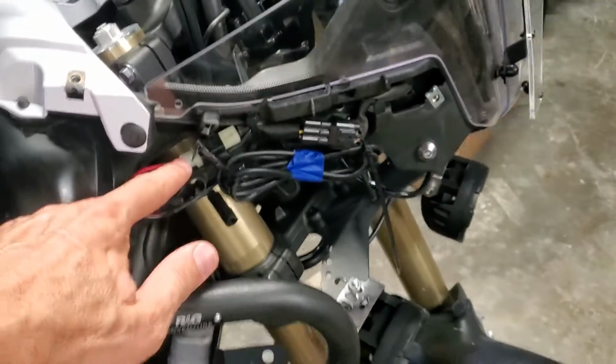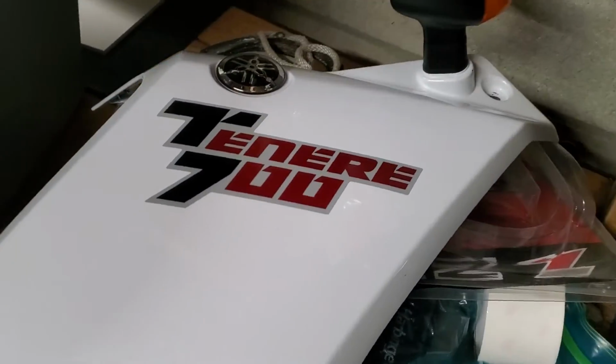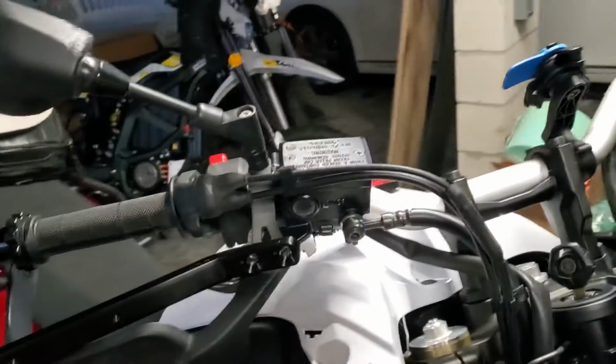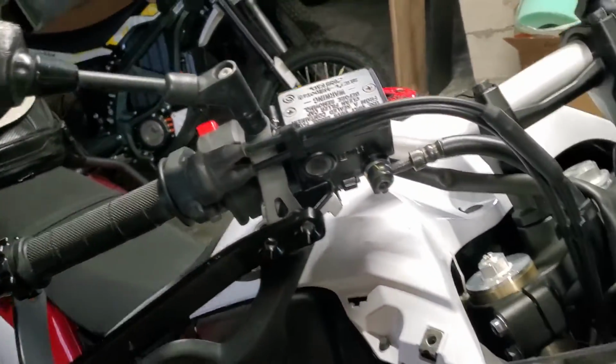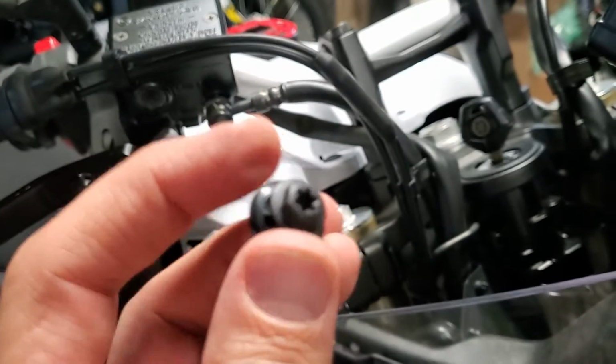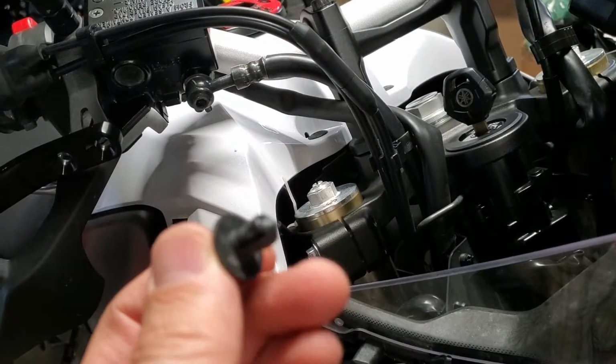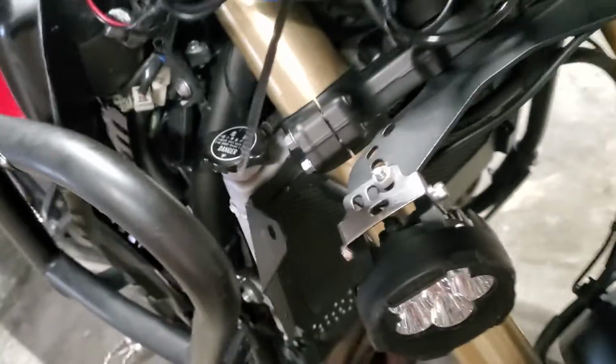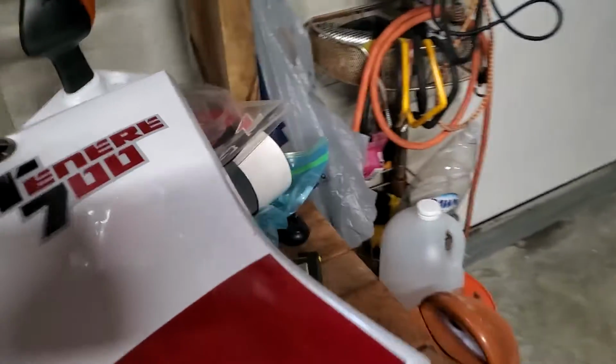Okay, your live plugs are behind this body panel, and that's the body panel. Now it's quite simple. There's 3 star head screws. Those are super simple. And then the other little trick is you will have a couple of plastic screws. Let me grab one of those so that you can see them and understand how they come out. Here's one. They also have the star head, as you can see, and you just unscrew it a little bit, pull it out, and you can see it's just a, what do you call it, pop rivet type thing, body panel. And those are down in the radiator guard area in the front of the panel. You'll see them. You won't miss them. They're on these tabs here in the front of the panel.